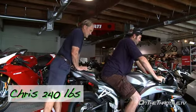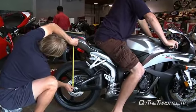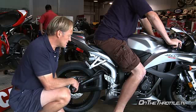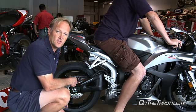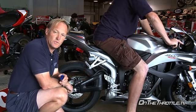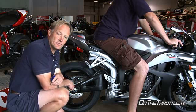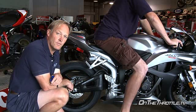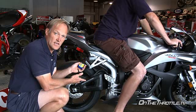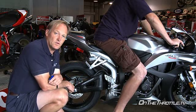At 240 pounds, he's right at 40 millimeters of sag, so the shock is definitely too soft in terms of springing — you'd want to re-spring the shock with a stiffer spring. Remember, when you get past 35-40 millimeters of sag, the back of the bike is collapsing and causing the front to extend, so until you fix that problem you're never going to get an accurate measurement. If you're buying this bike at this weight, very little weight is on the front end, and that's a huge safety problem.